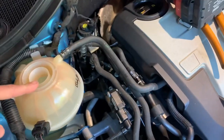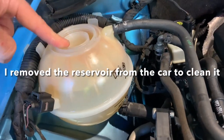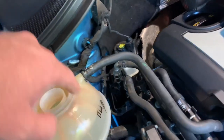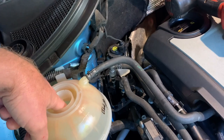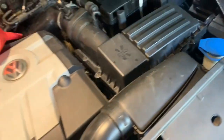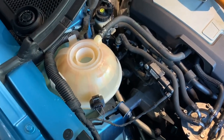So cleaning the bottle out was much more difficult than I was hoping, but I guess it came up much better than what it was. It's just really hard to get up inside these fins considering you need this big return on here. So anyway, I've put the clamp back on the bottom, this one back here on the top, filled it up with demineralized water. And water was coming out here as well, which is as expected. So I'm just gonna warm it up again. I'll do one final flush with the vacuum and then I should be ready to put coolant in it.